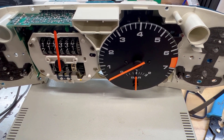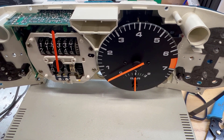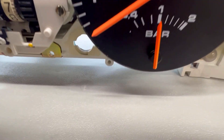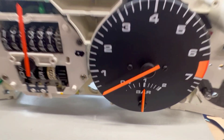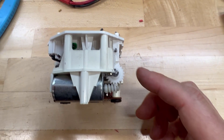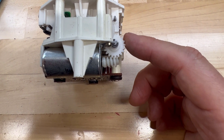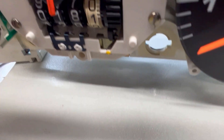You might be asking yourself why Porsche made that one gear in that weird material that falls apart. My best theory is they did it to make that gear softer, so it would absorb impact, so that it didn't make this noise. You can hear it kind of clicking away — that noise is coming from this worm gear. You can see how the worm gear drives the odometer gear, and there's just more play inherently. That's what that ticking sound is you hear when the thing is running.